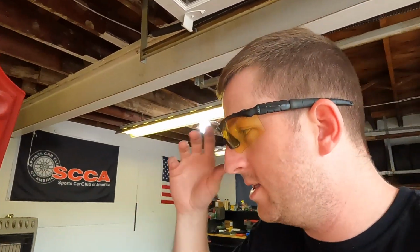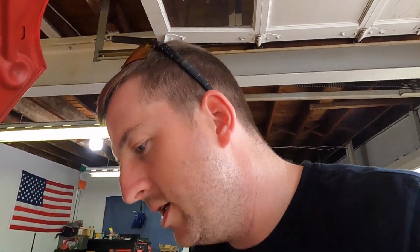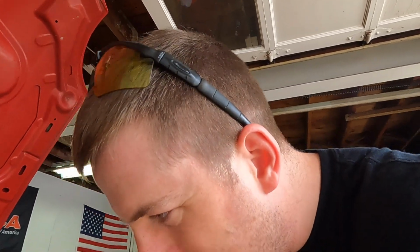So, back to the top side. I'm going to go ahead, get my air compressor set up, pull the intake pipe off, and then start pressurizing the system to see if there's anything noticeable. Hopefully there is. That'll make my life way easier, but if there isn't, then we're kind of just where we left off last time, right?